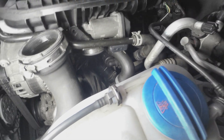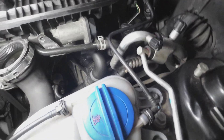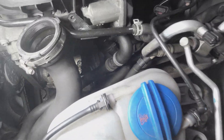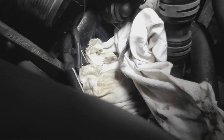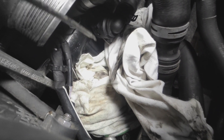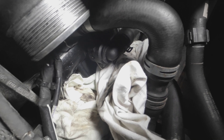Down there guys is the water pump where my hand is, just underneath the throttle body. I've got no choice - I need to start removing all the pipes. I'm going to be losing some coolant so I'm going to leave some rags down there. I've got rags in there now. The first pipe I'm going for - I pulled out the pin and then one to go back here. I'll take out the top two first and then there's one more at the bottom, so once those three pipes are out I'll be able to see that water pump clearly.